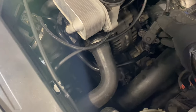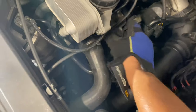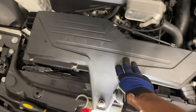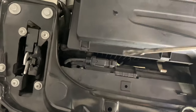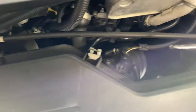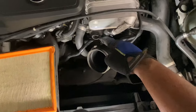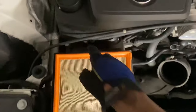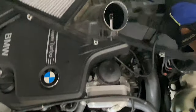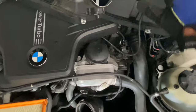We could leave this stuff in the way but I'm going to disconnect this hose and move it out of the way so the alternator can slide out easier. Remove this top piece - unclip these, lift them off, pull it right off. Used a flathead and popped these off - one, two, and this one over here. Then loosen this clamp, and disconnect this sensor right here, loosen the connector, move the wire out of the way, disconnect the three tabs, and swing the whole air box piece over to the side.